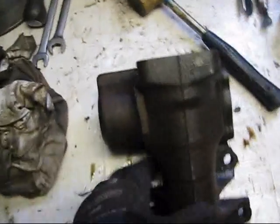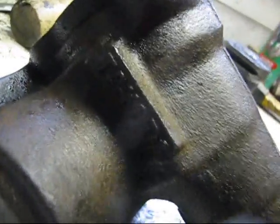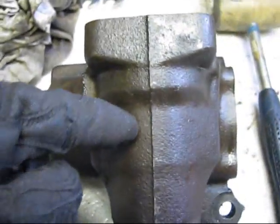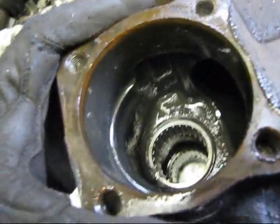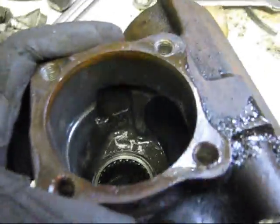Okay, when we tap our power steering boxes, I've seen people tap them in between the D and the A, or anywhere else along pretty much that path there, because that'll put it right about in there, just above that bearing, and it'll keep it out of the way of everything else. And that will be our turn left.